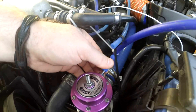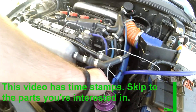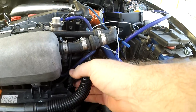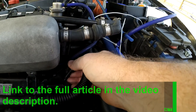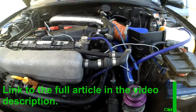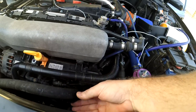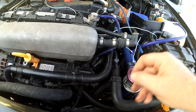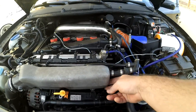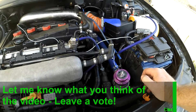To check what's going on here I've pulled off the vacuum hose and I can see there's no vacuum when the engine is running at idle. This hose goes back here and I've noticed a few things: one, we've got a broken pipe here which wasn't fully broken before but it is now - this goes to the secondary air circulation. Most worrying of all, we've got two broken hoses here. One of these is connected to the vacuum, so this would explain why the BOV is not working - it's not getting a vacuum signal to the top. So let's run a hose directly to the BOV from the inlet manifold and get this BOV working properly.